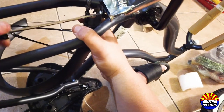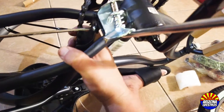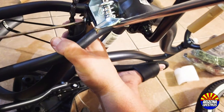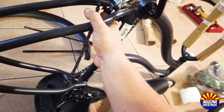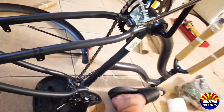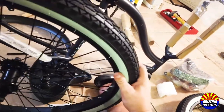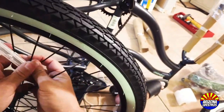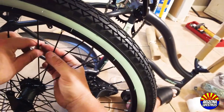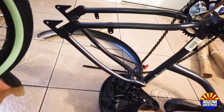You should now have access to that one Phillips screw by the kickstand. I'm using a flat head because the screw was stripped during installation. Once you remove it, the fender should fall right out. Now that the ugly fender is gone, let's also take off the reflectors before reinstalling the rear wheel. These come off easily — just slide them on the spoke, rotate, and the connector will pop right off.